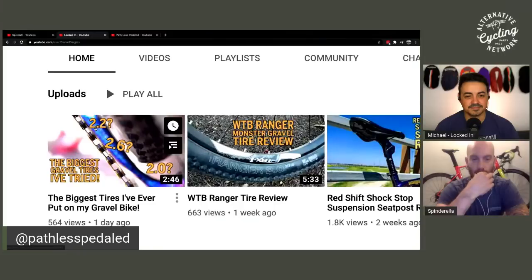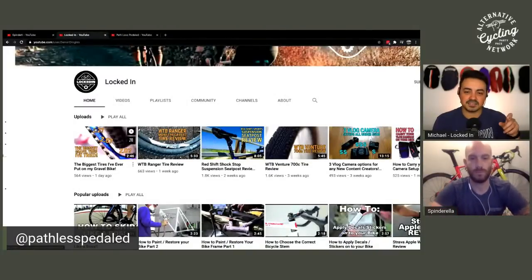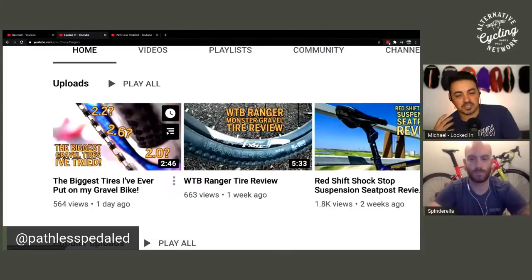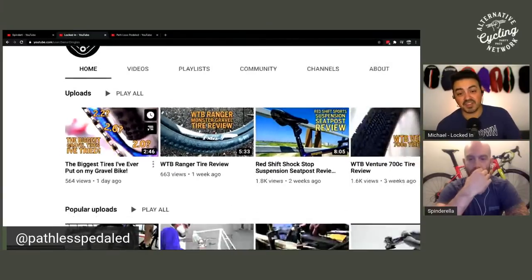Did you get a chance to ride with the really big tires yet? Yeah, it's great. Love it. A lot of it has to do with the tire and the casing and the tread profile, which I discussed in that video, if anyone wants to go watch it. I asked what people think the appropriate big tire is for a gravel bike. To me, the 2.2 that I have on there is the sweet spot because it's not overtly heavy unless you get some ridiculous ultra endurance casing. I'm running S-Works Fast Tracks now, which are a cross-country tire, front and rear. They're 550 grams a piece, which is what a 650 by 47 typically weighs, but it equates to something like a 50-53. So it feels just as lively, but you get more cushion. So I'm a big fan.